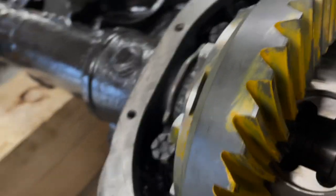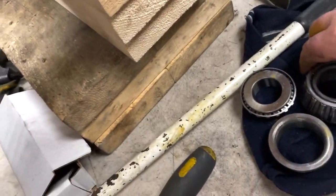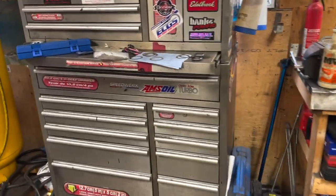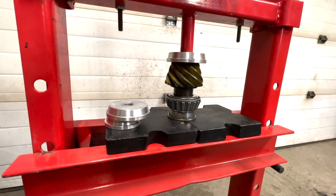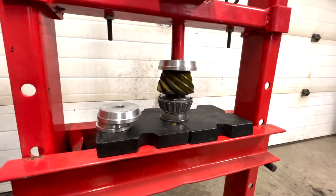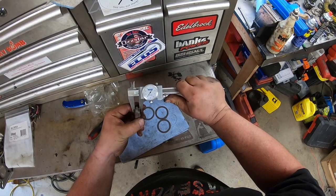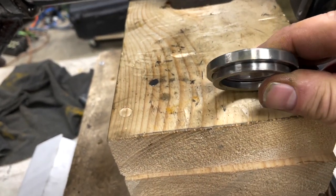Once you have all your corrections made and you're happy with the setup, you're ready to press the pinion bearing on. I've got my pinion bearing and also the crush sleeve eliminator that I'm going to be installing — I have a video on that. You need some sort of press to press the pinion into the bearing. I took another bearing race to push on the inside so as not to damage the roller bearings, and you want to make sure it's seated down fully. The crush sleeve eliminator comes in two parts with a bunch of shims so you can make it thicker or thinner. It's important to know which way the orientation goes.